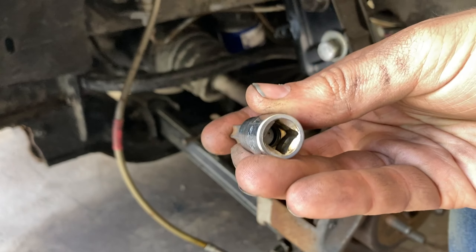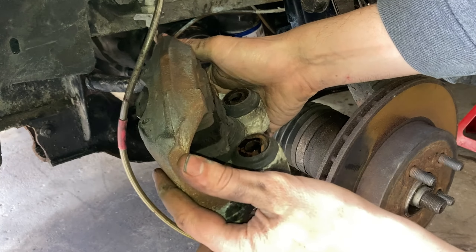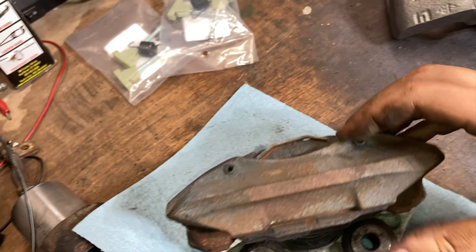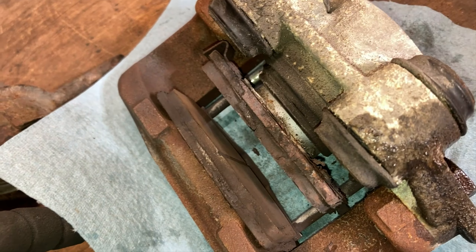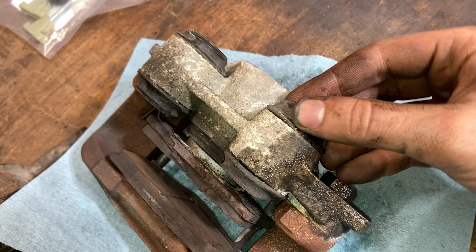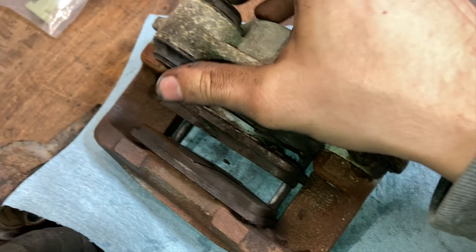To get the brake caliper off, you'll need a T55 Torx bit. There are two large bolts on the back of the caliper. Now the caliper should be free. You might just have to work it off because the brake pads are squeezing a little bit on the rotor. Go ahead and tilt this down to drain the fluid out. Then replace the banjo bolt and the caliper bolt for safekeeping. Since I'm replacing this caliper completely, I won't have to do some of the regular stuff you do when you change pads. You'd have to normally hammer these pins out in order to change the pads on this 88 brake setup. Also, you'd want to compress the cylinder again with a big C-clamp or a brake clamp in order to push it back in to fit the new pads. Or you might want to take this time to inspect the seals around your caliper.